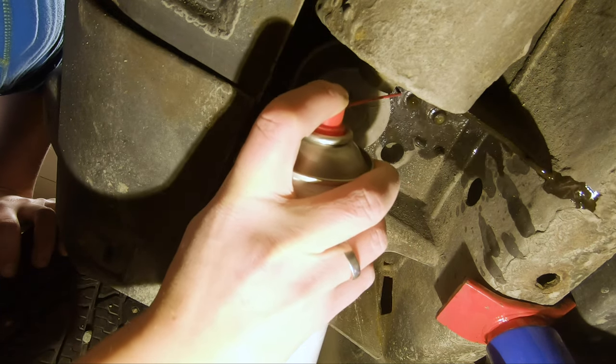That end is loose and this end is also loose. To get the tank out, lift it up off the catch, push it back so the catch doesn't catch, then take it slowly down at the front — you need to stop partway to undo the air connections. Need something to hold the air tank once it's loose because it's fairly heavy. There's so much dust, gravel and a big rock between the tank and the frame — that's why I'm struggling to get it down.